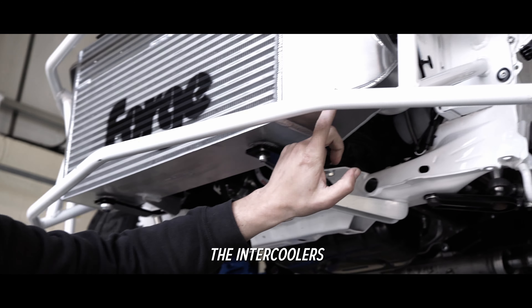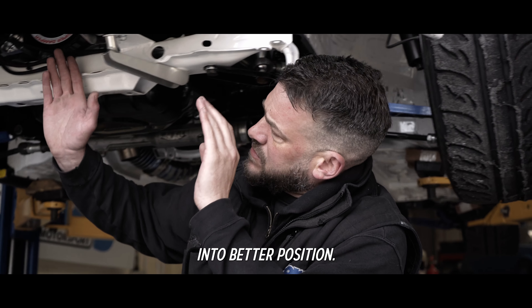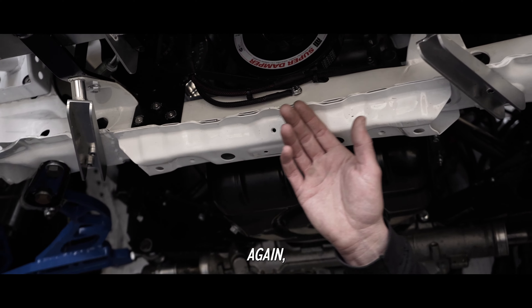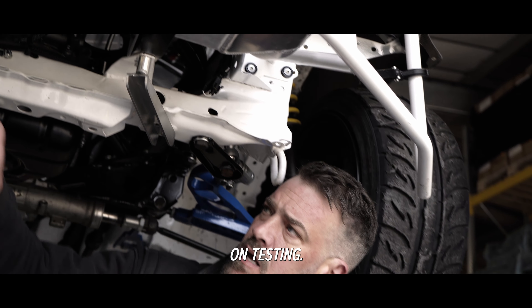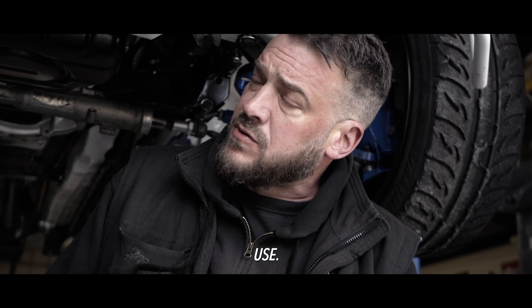I'm really, really super happy with that. I've also mounted the oil cooler - we've moved that into a better position, it's been moved over slightly to the right. Again, 3mm brackets. The old oil cooler unfortunately had fractured on testing and came loose from the intercooler - obviously we don't want that to happen in competition use.